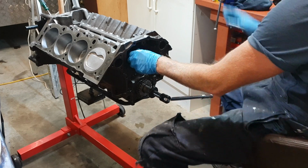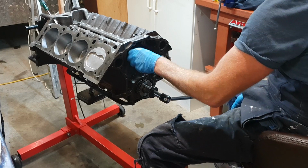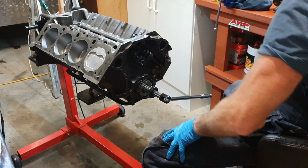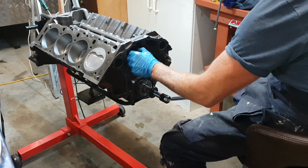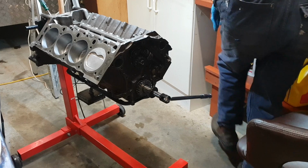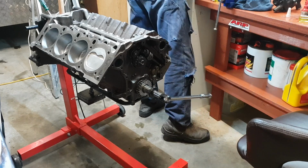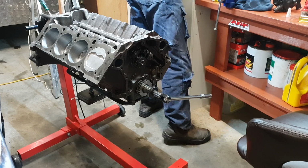You've got to remember, guys, every time I bring this car back from the track, I'm going to drain the fuel. So we're not going to have any issues, even if I just run a little bit of pump fuel through it, put a litre in it and fire it up and just let the carby sit with a bit of pump fuel in it. But it's not going to sit with E85 in it while I'm not using it. That's what I'm sort of getting at. So I think my fuel line should be right.